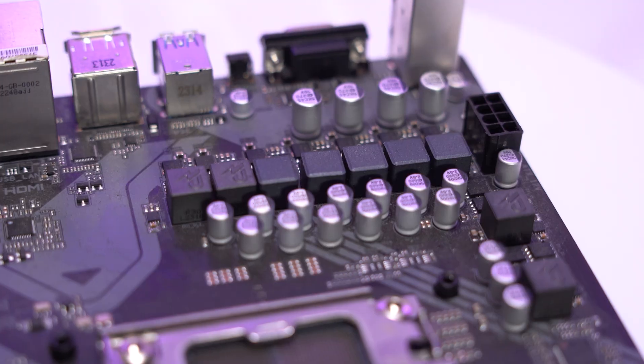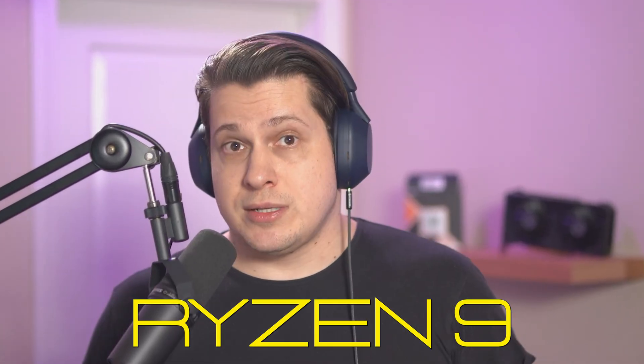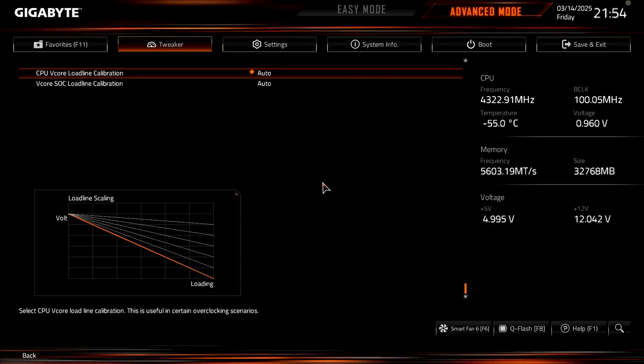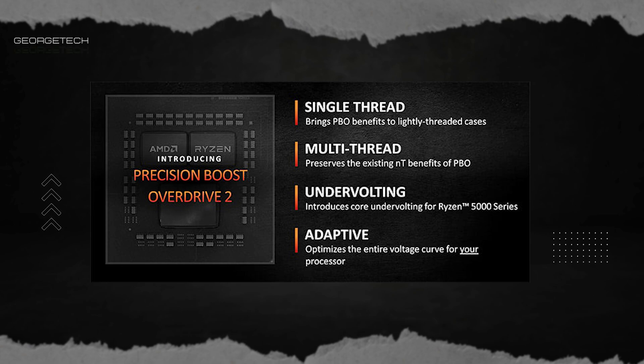The absence of VRM cooling on this motherboard isn't actually a problem. It comes down to the A620 chipset spec and Gigabyte's decision to follow it. TDP is locked at 65W with a peak power tracking limit of 88W. The Ryzen 9950X3D can run, but it can only walk. Run a Cinebench test and you'll see CPU utilization hover around 70%, with scores mirroring an 8-core AMD chip. Trying to change VRM power delivery to extreme won't help — the power limit stays limited. PBO is not an A620 chipset feature, so there's nothing to cool; the board simply refuses to let the CPU hit power levels where overheating could be a concern.